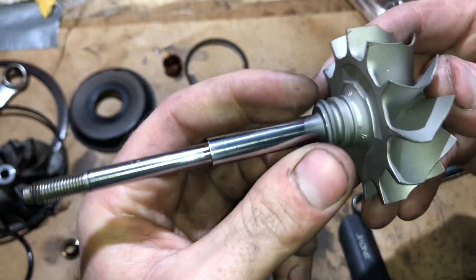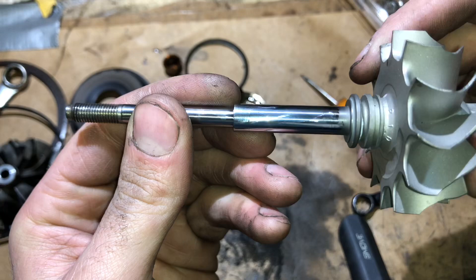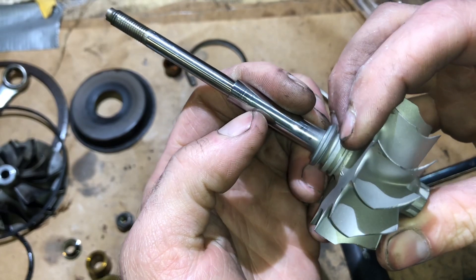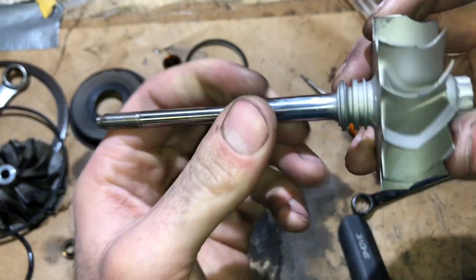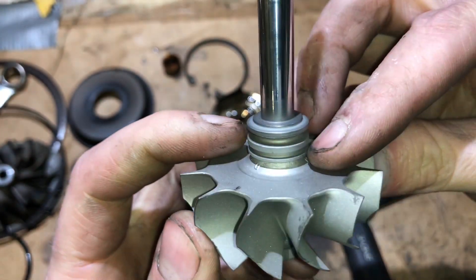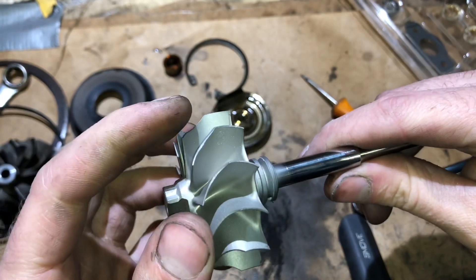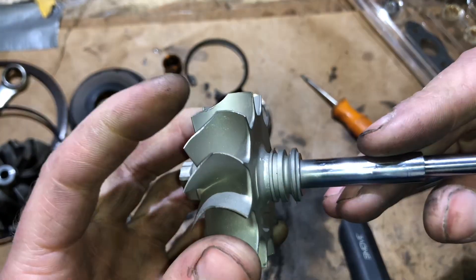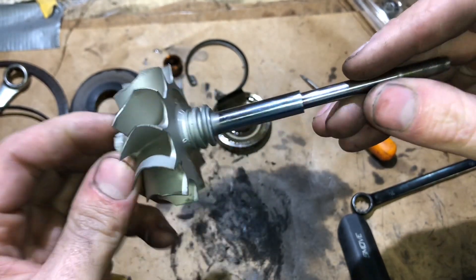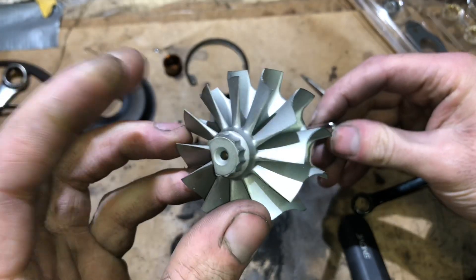On the turbine shaft, you want to polish it up — you could use Scotch Brite, but I prefer to use some polish so it doesn't damage the tolerances at all. You want to check for scarring here. This one's got a little bit, but it's not dug into the shaft, so this one would still work. Then you want to check the gap and make sure there are no areas dug into the turbine or shaft that will cause oil to leak past the piston ring. Because this one's got damage here, it really shouldn't be used. It may still be bent from rubbing against the housing, so I would just recommend replacing it.